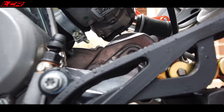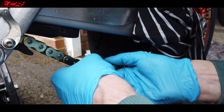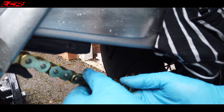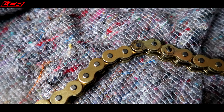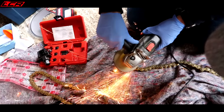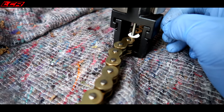Is it 13? It says 13 — that's going to be a taller gear then, isn't it. I was going to go 14/42. I'll try it. Let's count the links. You want to keep the inner — no wait, you want the outer so you've got an inner for the clip. Of course — so we're going to cut that one, grind it down, punch it out, and then join it.